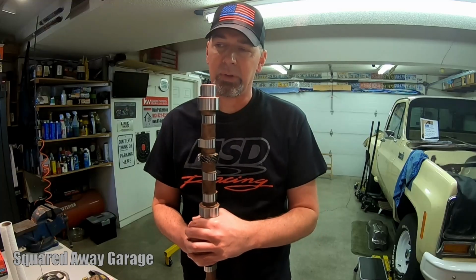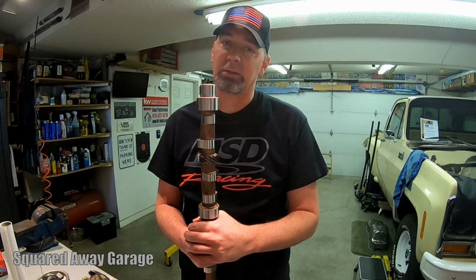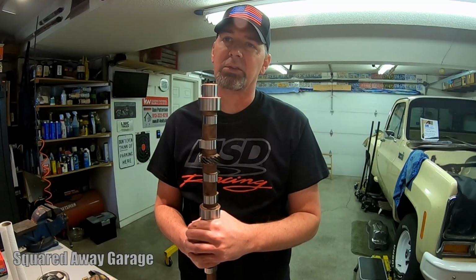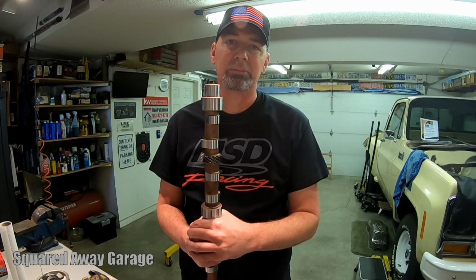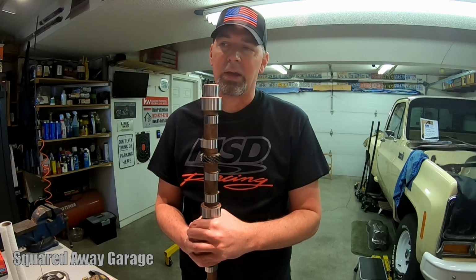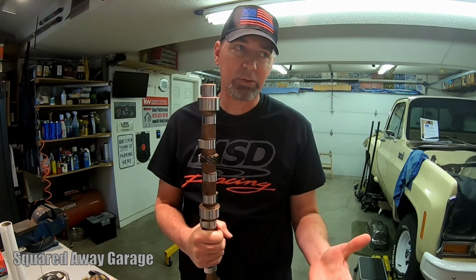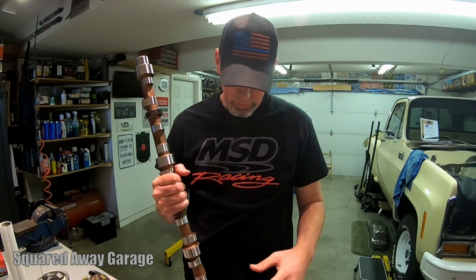And he kind of broke it to me. He said it's going to make a difference for your engine, but it's not going to be 100% what you want. So that kind of sucked. He said, without it on, you could probably tune that engine to 85% of what it's capable of. Turn it on and you may get another 10% out of it. But he said it's that last 5% you're never going to get with those Siamese port heads. Which is good to know, but it also was a little bit disappointing.